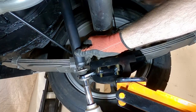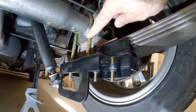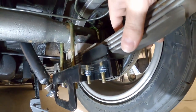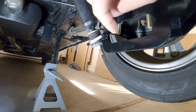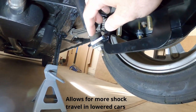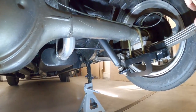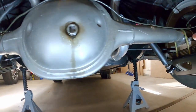A good time to point out that these spring plates accept 7/16ths and 1/2 inch U-bolts depending on what size you have — whether you've got the 9-inch rear end with larger tubes or whatever. I also like these little capture pieces that center the spring plate on the leaves themselves. You may notice I had to jack this up because the location is lower than what the fully extended shocks can reach, so I jacked it up and put it on. We're still supported by the frame — we're not supporting the axle because we don't want to do that yet.